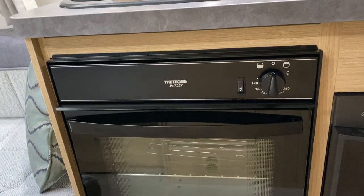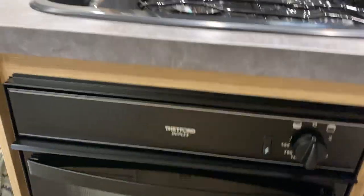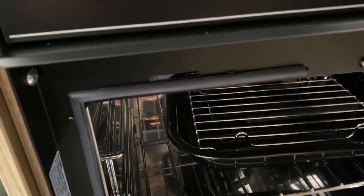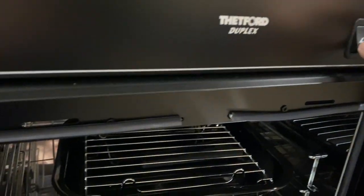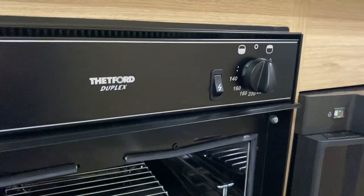The oven works off gas only. The igniter here works for both the oven and also your hob. To operate the hob, press and turn the knob while pressing the igniter — that will turn on the hob. For the oven, turn to the left then press the igniter; you can see that it's illuminated, then depress and turn it off. For the grill, press the knob in, turn it to the right to the grill position, then press the igniter and it will ignite. Depress after about three seconds once the flame has had time to warm up the thermocouple. To turn off, just turn to the left into the centre.